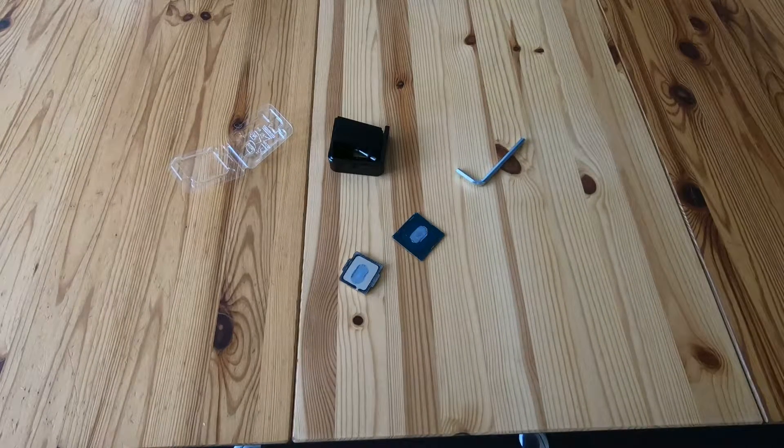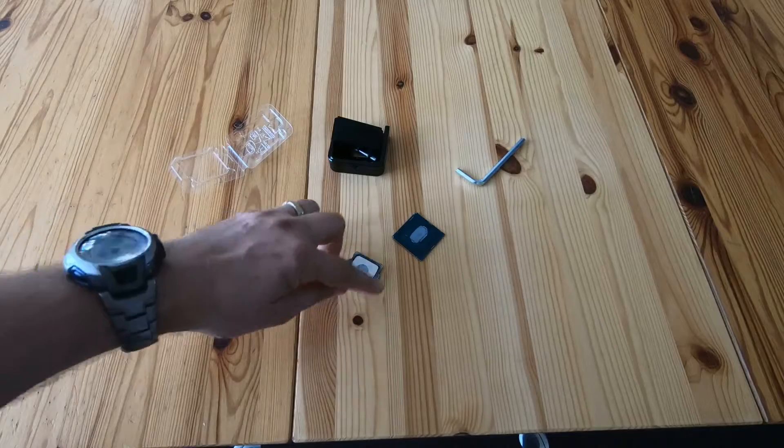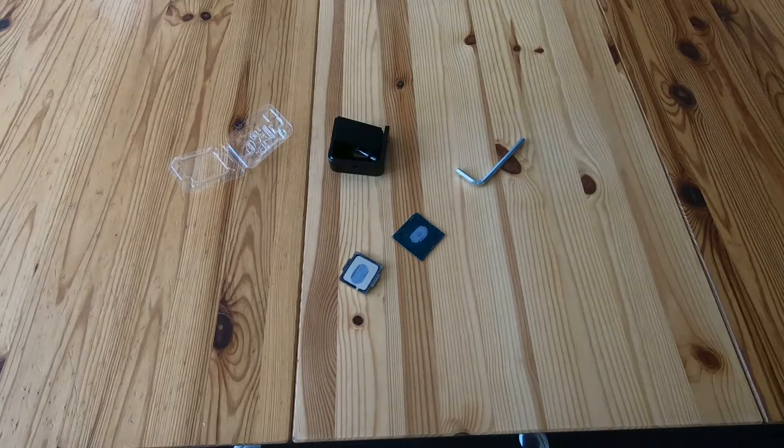The next stage is to get rid of all the thermal paste that Intel put on, and get rid of the glue around the outside. To do that I'm going to use a little bit of plastic — if you've got Araldite you can use the plastic spreader that comes with it. I wouldn't use a knife for obvious reasons. You could cut up an old credit card or use your fingernail. The compound comes with little cleaning pads, and there's also TIM cleaner you can get. I'll clean it all off and then do the next stage.